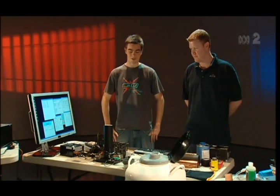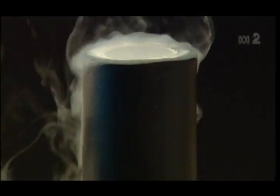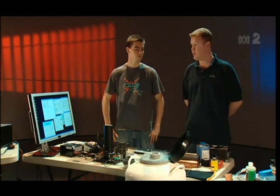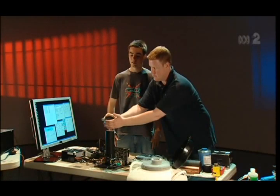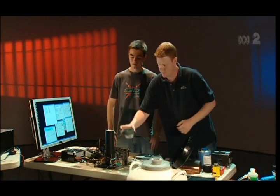So why on earth would you do something like this? With dry ice you can pretty much get to some of the top overclocks in the world just with a simple copper tube and a couple of dollars worth of dry ice. So with a little effort you can get quite a lot of results. Is dry ice safe to handle? It is very cold — about minus 78 — but as long as you use a cup to pour it in and don't handle it too much, you should be right. It is compressed carbon dioxide though, so it can evaporate and build up, so you've got to be careful and do it in well ventilated places.